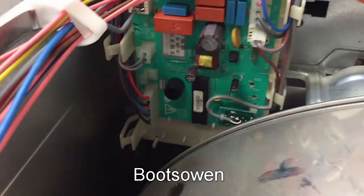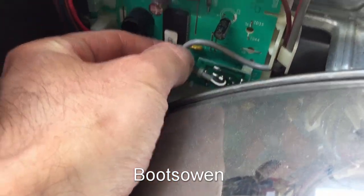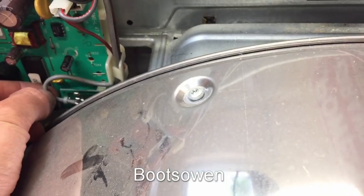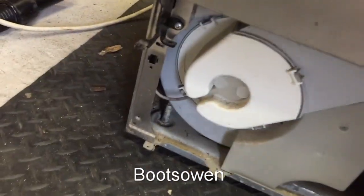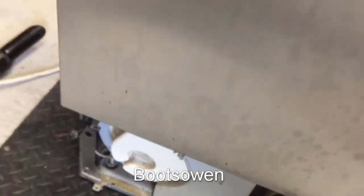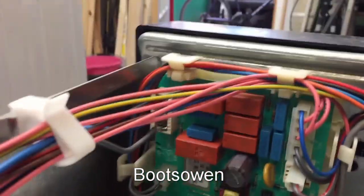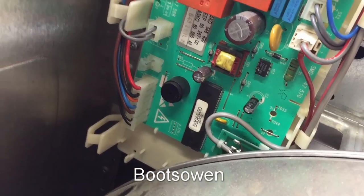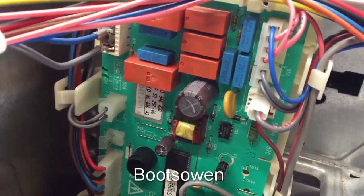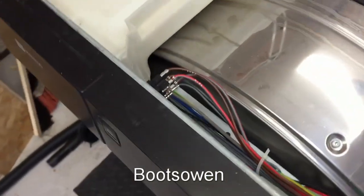Over here is your control board. The first thing I noticed was this little board attached up top — it has a data cable coming over here, and I think that goes down to the lower front to what I think is some kind of a sensor arrangement — either water or something like that down there. Back up here, that's your main power switch. There are a load of relays, a couple of capacitors, and a big chip. It has an LCD display so it needs a bit of thinking power behind it. There's another board behind the LCD, which makes sense. Let's fire it up and see what it does.